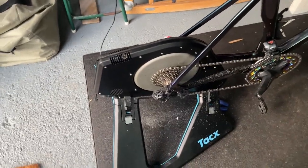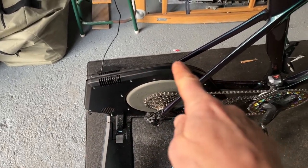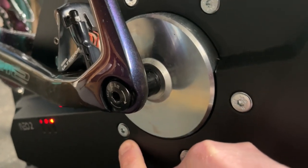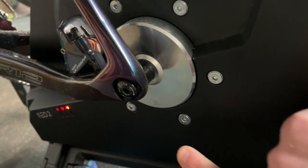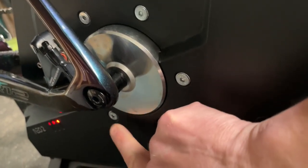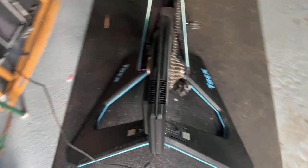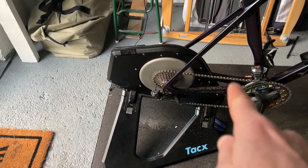Basically, I've put a rubber gasket along this edge — the top edge — there it is. I've also released this bolt about one turn, because once I put the gasket in, after I finished the ride I pushed here and it was still creaking. I just undid this bolt maybe one turn and it completely silenced it. Now I'll show you what it looks like inside.